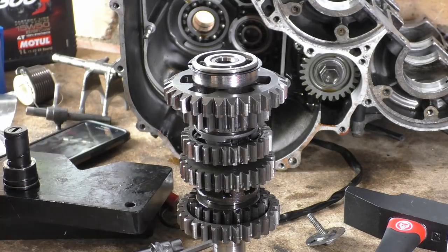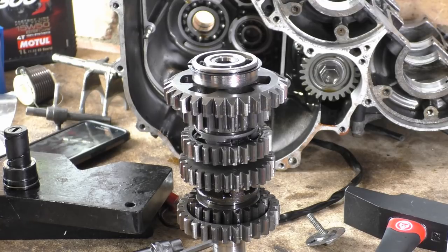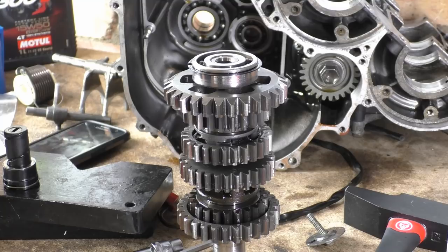We have just invented our thrust washer - basically it's a spacer at the end of the day. We'll have a look at the crank in the future and do a video on crank end play, which is very important for two strokes but also important with four strokes - they just have other means of securing themselves from thrusting too much. Hope that makes sense and I'll see you in a bit.